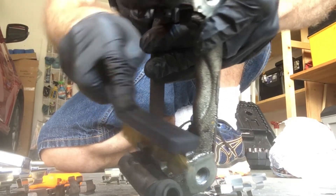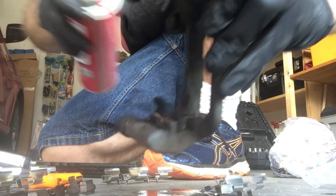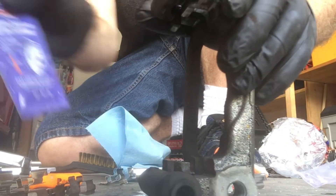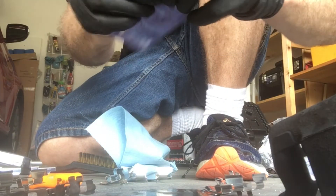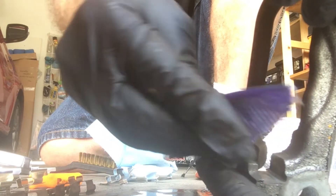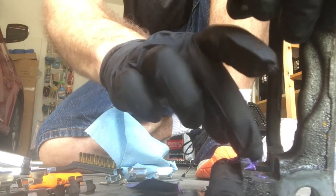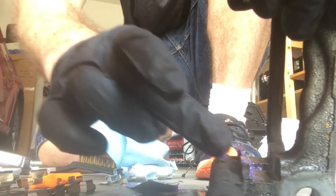Just a little clean so it's got a smooth surface. Not really a lot of rust. Be careful you don't wire brush your caliper bolt boot — you can take them off if you want so you don't get them too messed up. Now you just want to use the grease — not a whole bunch, but we've got metal on metal.